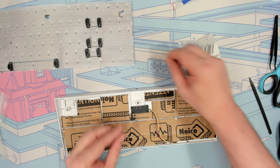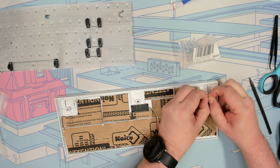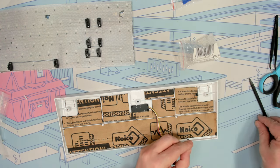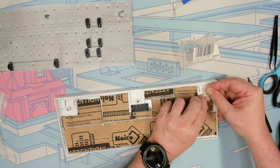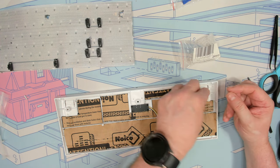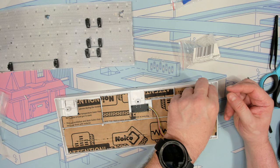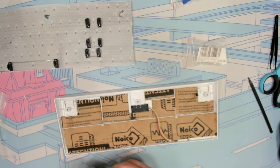With the O-rings that I put in there, I actually do have the tiniest amount of flex, so it is not as bad as, say, a standard tray mount. It's closer to a sandwich mount with just that tiny amount of flex, but at least it does not feel like typing on concrete, as there's actually a little bit of give. So it makes for a much more pleasant experience.